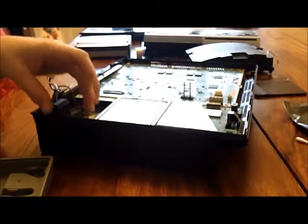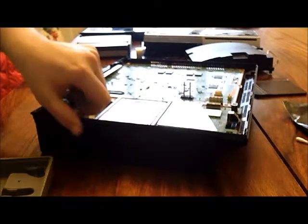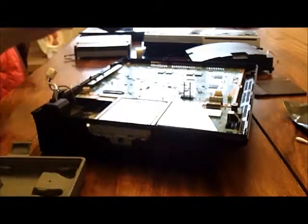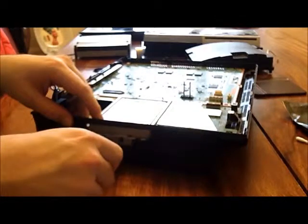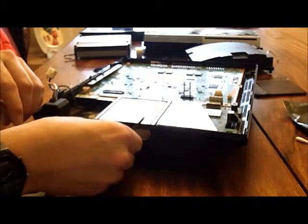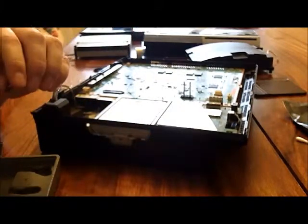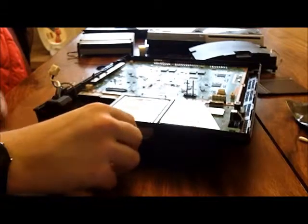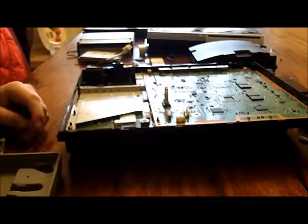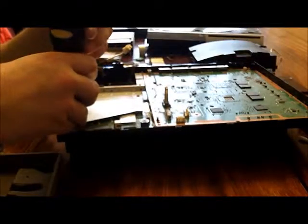Now you want to take the hard drive out. You either reach inside and push it out, or you can use a spudger and pry this door out. Once you're inside there's a small screw which just unscrews like that. Reach inside and pull this little tab out — straight out — and out comes your hard drive in its little case. Now we're going to unscrew a couple more things and we can finally lift out the motherboard from its case.